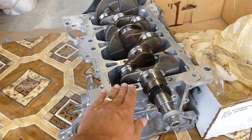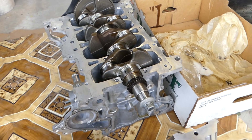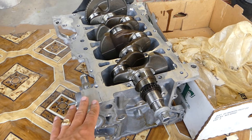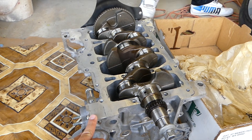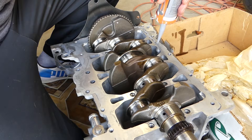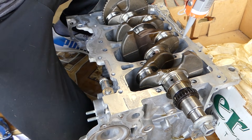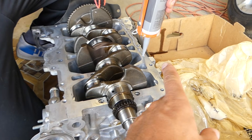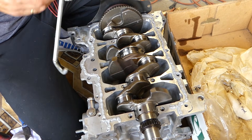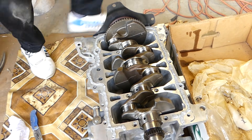This half needs to be super clean — degrease it, use alcohol or acetone to make sure you don't have any greasy spots, and the other half as well. This is because we need to apply sealant. If you don't, you're going to have an incredibly big oil leak, and the only way to fix it is to take everything apart again. Apply the sealant on the inner side around the engine bolts. That's how we applied ours — you actually have to go on the inside of the hole, but we went on the outside as well.